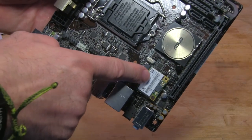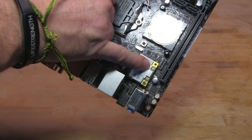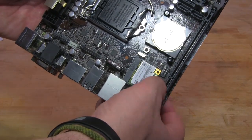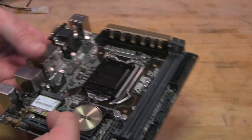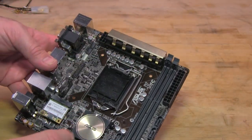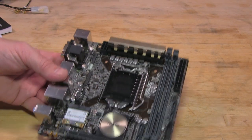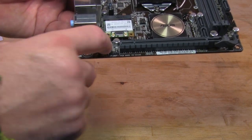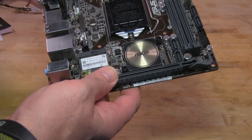Down here you have your 802.11ac wireless module. Those cables we talked about connect right here — they can be a little bit difficult, but once you get them snapped in they're pretty much good to go. Of course you have your battery. The board is well laid out — looking at the tracing, it's very clean. All solid Nichicon caps. There are a couple of caps down here that look like they're not solid, but those are used for audio and actually help give you a cleaner audio signal.